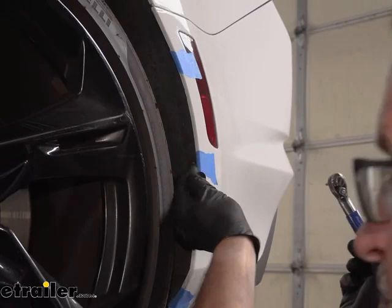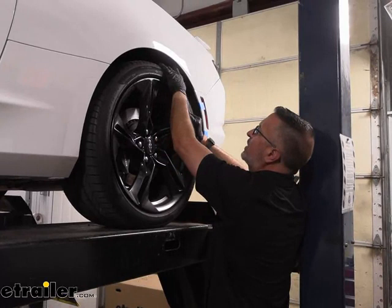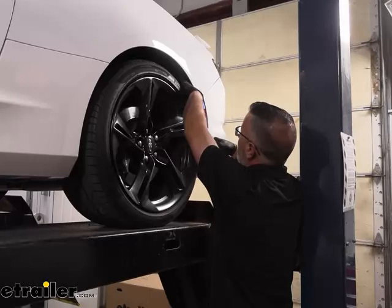Take your finger and up here about the 1 o'clock position, you'll be able to get under the fender well — the inner wheel well liner — and you're going to want to peel that back. Right here, just above the reflector, we have a 7-millimeter bolt that's sticking straight up. We'll access it from the bottom and need to remove this. Do this on both sides.